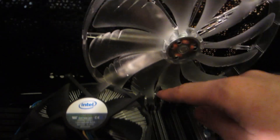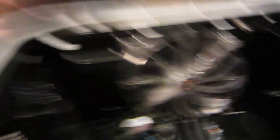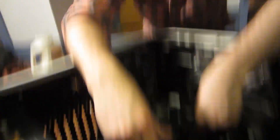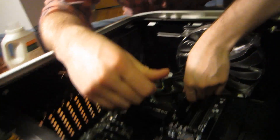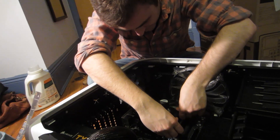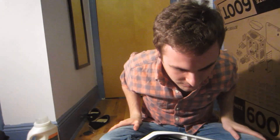Do these say what number they are? No — it's the slots on the board that matter. So we're going to put them in these slots. Make sure you de-static first, and you're going to get to slam them down and have super fun. See how it's a little bit shorter on one end of the slot? You want to put that going towards there. Put it right in there and push down so those little hooks on the sides pop up — push down hard, alternating each end. That sounded very good. Not too bad, right? Now do that three more times.